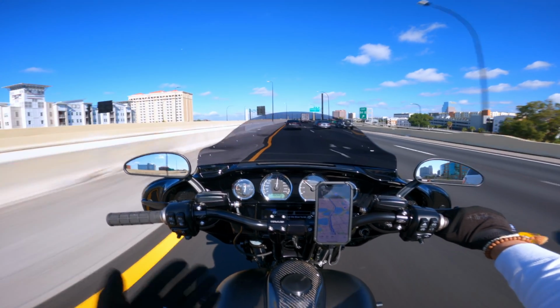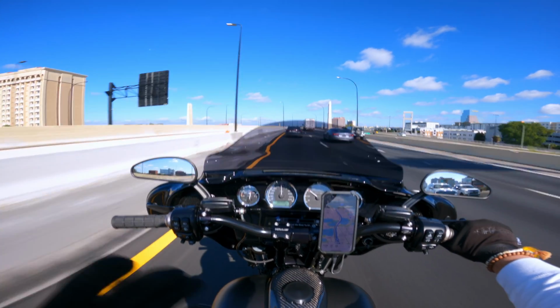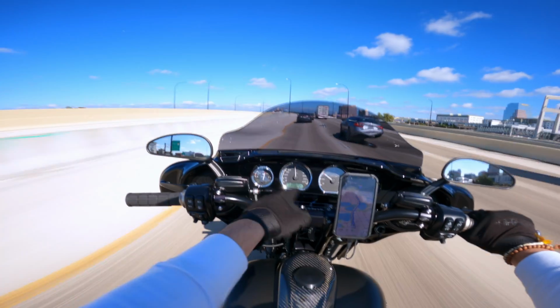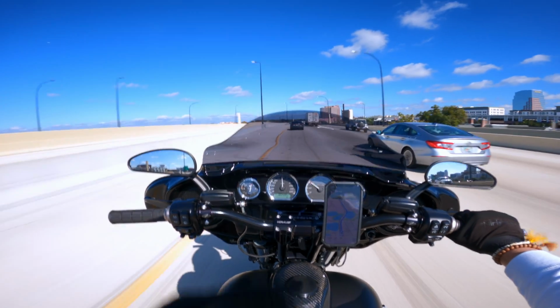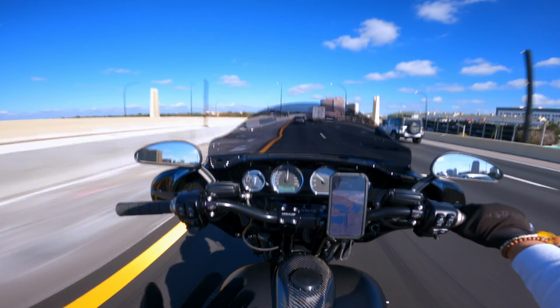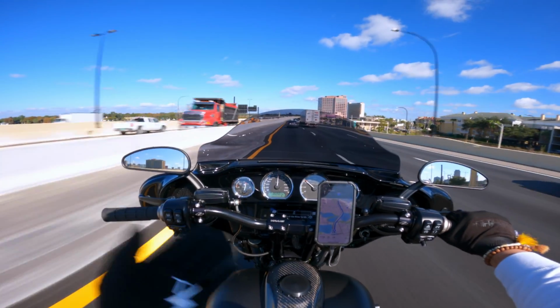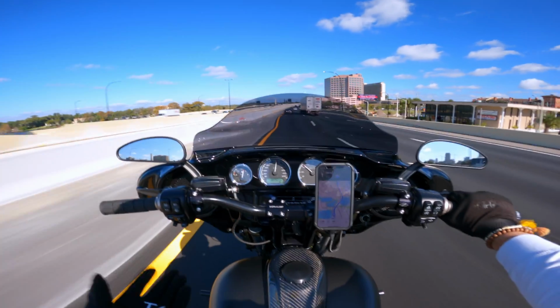So the other thing that I just noticed when trying to do it is cruise control. Cruise control also does not work right now. So I'm assuming that this also has to do with the whole gear selection indicator not working, as well as the speedometer. I'm assuming it's all the exact same issue. The ECM has to be reflashed by Harley, or your shop, or put it on a tuner and that'll solve the issue as well.